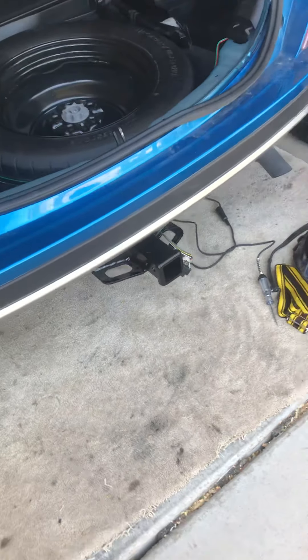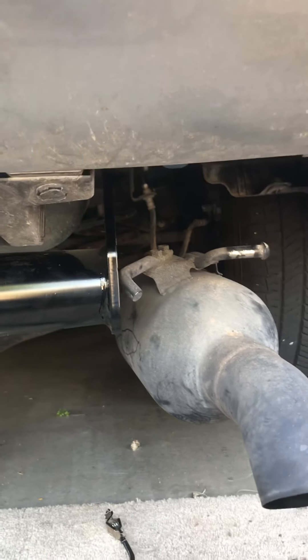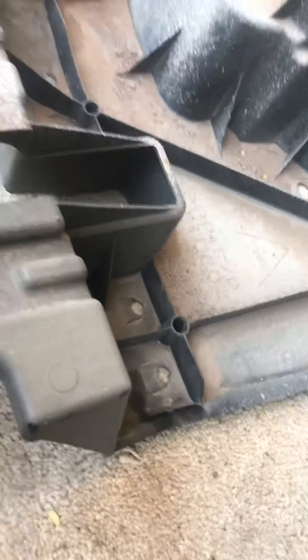The Reese instructions are pretty good — the hitch is pretty simple, we'll cover it real quick just to show you. You've got two bolts right there. What I did was I dropped the exhaust hanger here and dropped the exhaust hanger there, which allows the exhaust to hang low enough to get to those bolts with an impact gun and get that slid in. On this side over here you have this little plastic panel that sits under there.